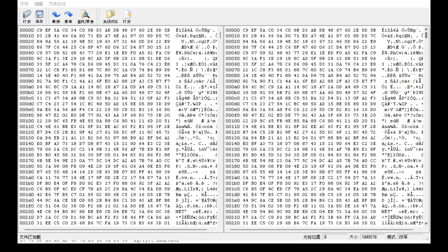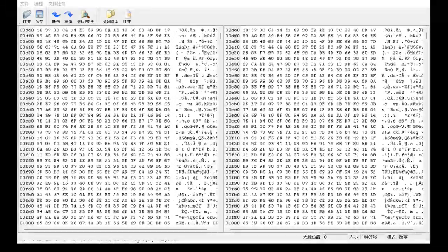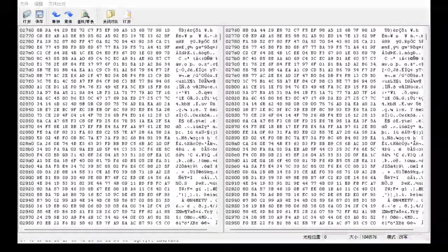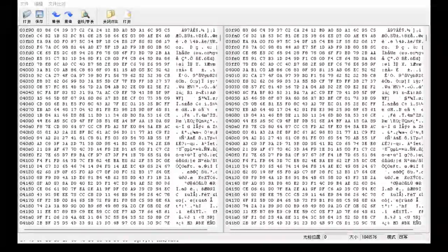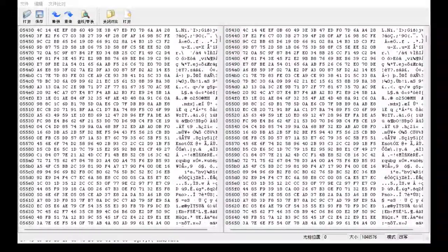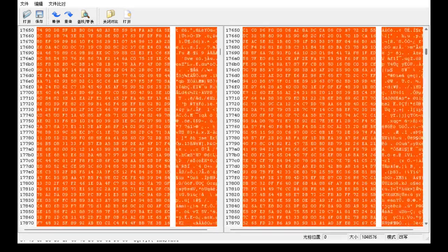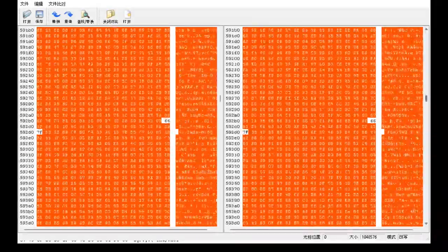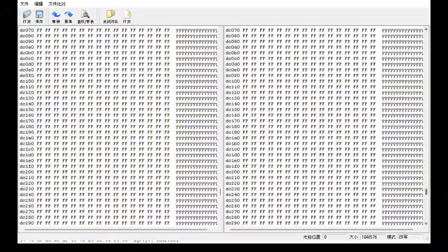Okay, there's J. Lots of it is the same at the very beginning, but it soon goes very different very quickly. And this is a lot of the reason why you can't swap SSDs. This is like a shadow, but it's encrypted, so nobody has really got into it yet. But they say, look, this is where it starts to be different. Anything orange is totally different. So you can see there's quite a lot of difference in places between the NORs, okay?